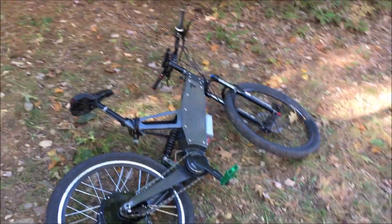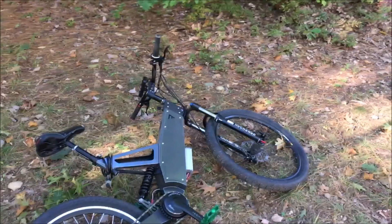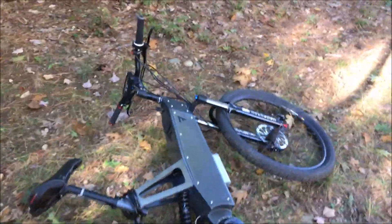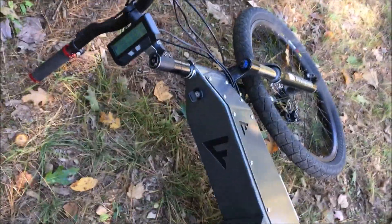I'm out on the Future Beta doing a little Luna Cycles battery analysis — it's not as bad as I thought. I'm trying to break it in, keeping it under about a thousand watt load, and it seems to be doing alright. It floats back up to 78, 77 volts when you leave it alone, but the second you get under load it drops to 74, 73.